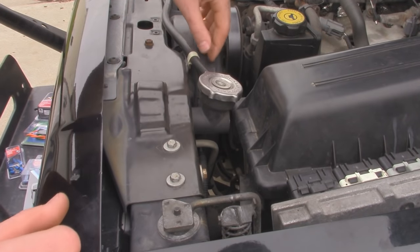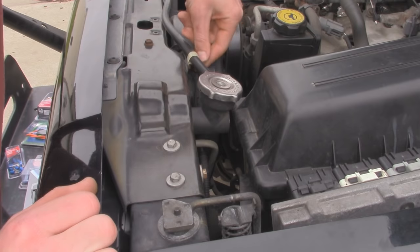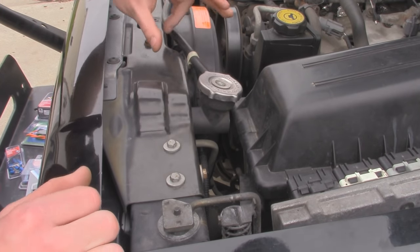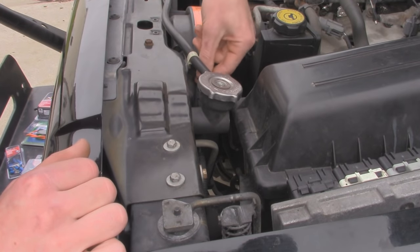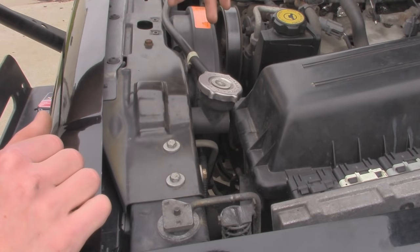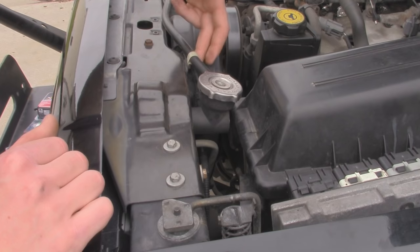For our install, we're going to start underneath the hood. Right here we have the wire harness that goes to the electric fan — they got two wires going into it, and we're basically just going to tap into the positive wire here. We're going to do it on the electric fan side so that way we don't hack into any of the factory wiring. So we're just going to take a wire and splice it into the positive power wire for the electric fan over here.